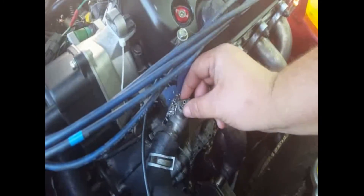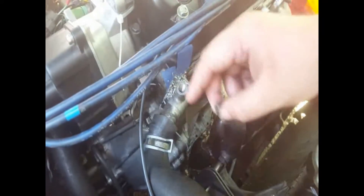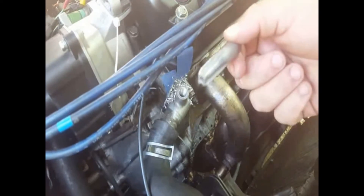Basically there's a bleeder valve on this little thing right here. You just take that bleeder valve out, and conveniently through the magic of Hollywood we already have this drilled out with the drill bit of the correct size. Then you tap the hole with the tap of the correct size, and then you clean it all out. As you can see we're not quite there yet - we don't clean things. Then we'll thread in our new temperature gauge, which is mechanical.